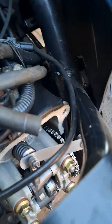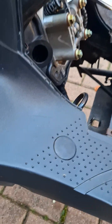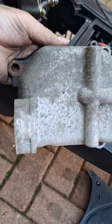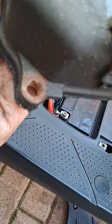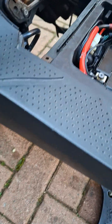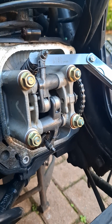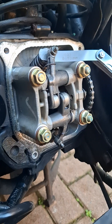Then you prize this tube off the valve cover. The valve cover itself comes off with four 10-millimeter bolts. I had a little bit of difficulty with one of them — it was rusted, the threads had a little bit of corrosion. That reveals the valves and their rockers.